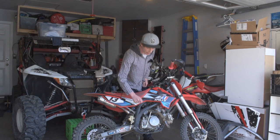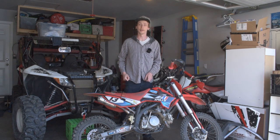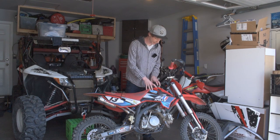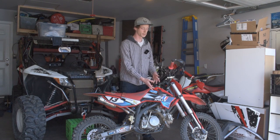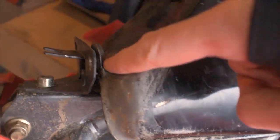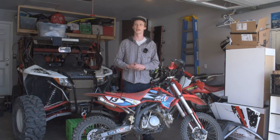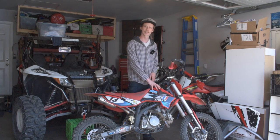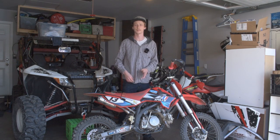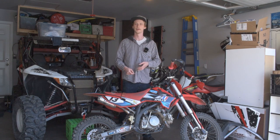Shortly after that, I bent another rear brake arm, then ended up breaking one of the brake toes right off — snapped it clean in half. After that, the original metal gas tank actually cracked at one of the welds and was leaking gas everywhere. As you can see, there's old JB weld where the tank continued to leak, all because of a bolt cracking the area. I originally lost the bolt that held the gas tank and put in a different one — the small welds couldn't hold up and snapped, and that's where it started leaking gas. I've since upgraded to a plastic tank, which just doesn't crack since there are no welds. The metal tanks are literally as thin as a pop can — you can't even weld them because you'll just weld right through the material.